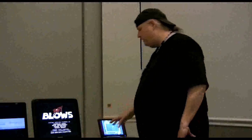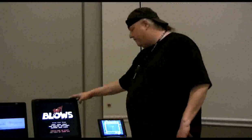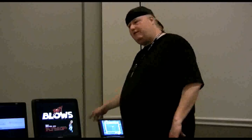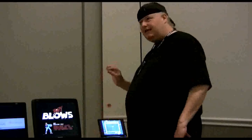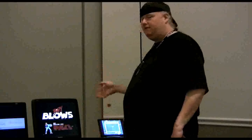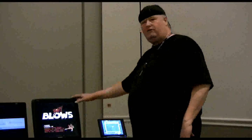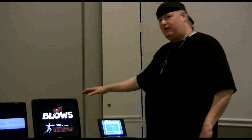It's really nice. So this one is an A500 and doesn't have a lot of memory. It has a real 68000 though, so it doesn't have to, like that one has to flash 68000. This one they put a real one in there. So it's slightly different, it's like a 16 megahertz 68000, so they play with the clock. But you can actually overclock it. There's a thing in here where you can tell it to boost it up.